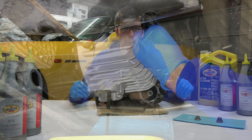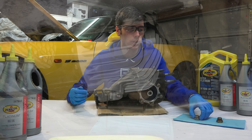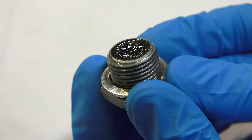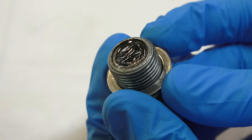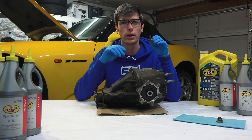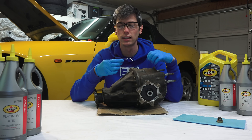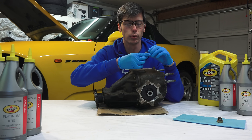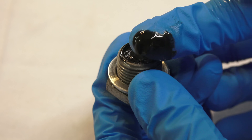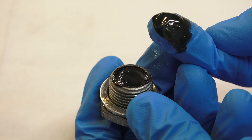After those initial 500 miles, you're going to want to drain and change that oil out. One thing that can be useful is a magnetic drain plug. This is actually the stock magnetic drain plug out of my S2000 — some vehicles will come with it, some may not. It's a good idea to get one and put it on the bottom of the differential so that any minor metal shavings coming off during break-in will stick to it rather than continue to pass through the differential with the oil. You can see on this one there is a fine powder of metal that has been ground off from that break-in process.